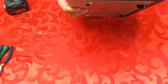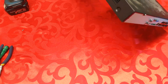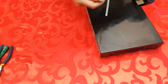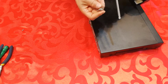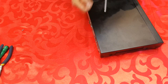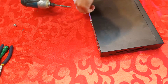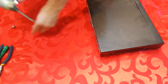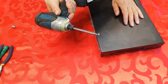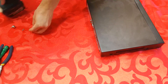You'll notice that there are often a myriad of screws. In this case there are six screws. What I recommend you do — these screws are very small — get a neodymium magnet or another magnet and just magnetize your tools so that you are able to pick up the screws without them dropping. For example, now the screw came out and doesn't fall on the floor. Especially if you're on site, in a roof, or wherever the NVR is installed.